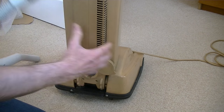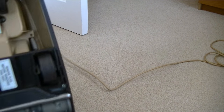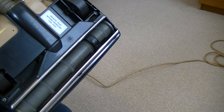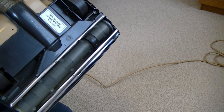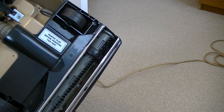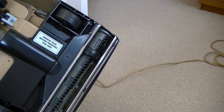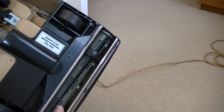Let's have a look at the underside of the machine. I'll see the brush roll rotating. It needs a new belt — I will fit one — but for the purpose of the quick demo I'm about to do, I don't think it needs one right now. The brushes certainly look in good condition. It might be slipping a little bit — we'll soon know when I start using it, but I think I will need a new belt. It doesn't seem very tight at all.